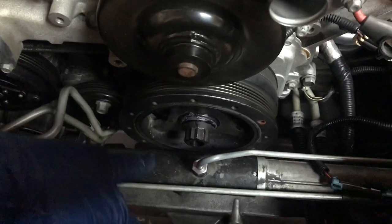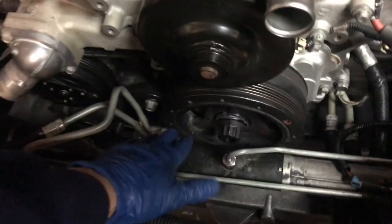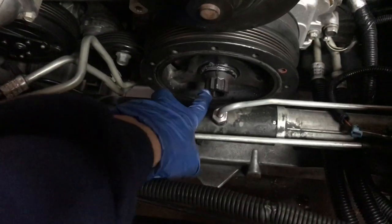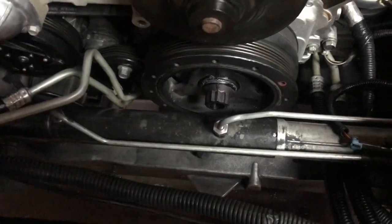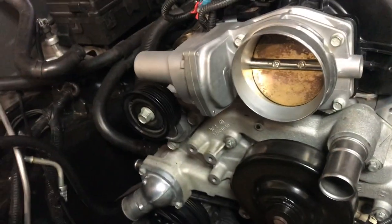All righty — I finished everything. Both rocker arm sets are torqued down, push rods are in, everything's oiled up. I had to take off the rack again to turn the crank over to make sure there was no piston-to-valve interference — so leave your rack off until you're sure you don't need to turn over the motor anymore. If you had the standard crank pulley bolt you could fit a regular 24mm wrench on it and turn it over, but with this ARP bolt you need a socket. I'm happy to announce there is no piston-to-valve interference or touching. I'm going to go ahead and pour some oil on top of both sides, then seal up the valve covers, and after that attach the alternator and all the power steering stuff.